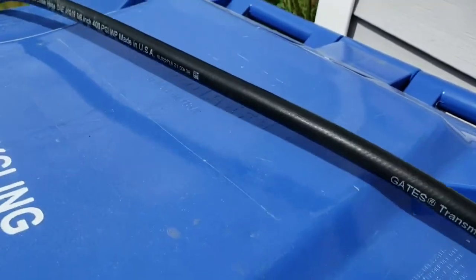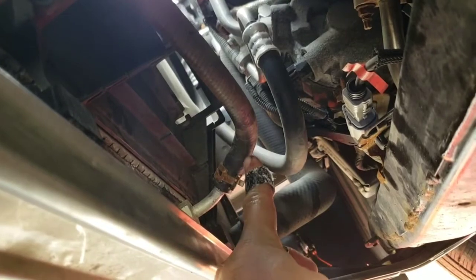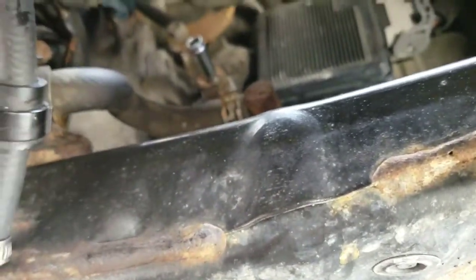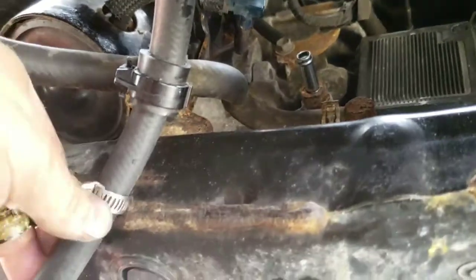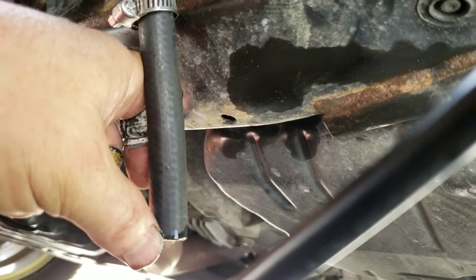You're going to need about 6 feet of hose. Looking underneath the vehicle — that's the transmission line on the passenger side of the vehicle. That's the pressure line, so the transmission fluid is being pushed into the radiator, comes across, and then comes out this line right here and normally goes right back into the transmission. But now it goes up to the cooler and the lines come back from the cooler. Before you connect this — there's the connector for it on the transmission — you're going to run your system and verify you get transmission fluid coming out of this hose on the return side. That means it's got pressure and it's pumping uphill into the transmission cooler and back down.